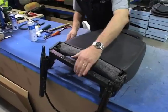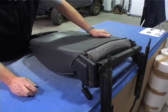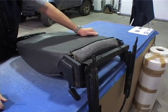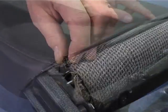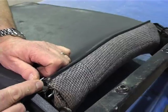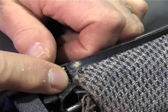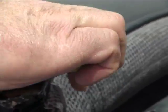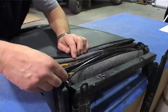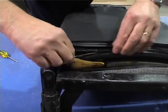The next thing we have to do is take the back cover off. It's easier to leave the seat frame complete because it makes it easier to work on when pulling the cover back on. The first thing we need to do is release the retaining bead — get a small spike and poke it up the end until it separates. It's a little bit fiddly. Once it separates, you can either pull it apart or use a tool to prise it apart. When you separate your cover, watch out for old retaining bars as they sometimes slip out the back.